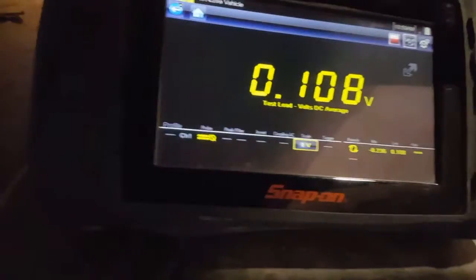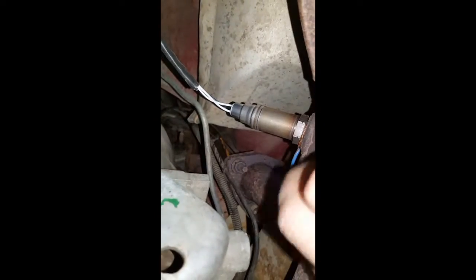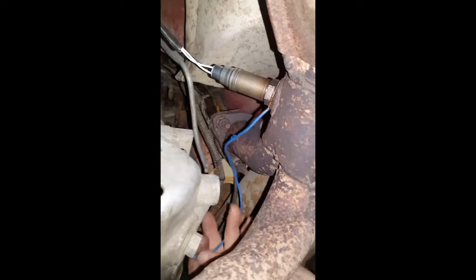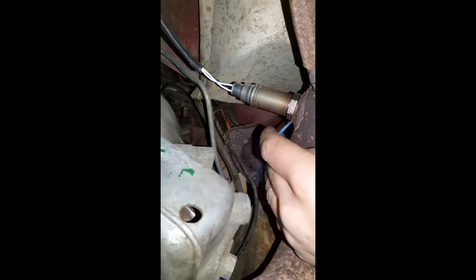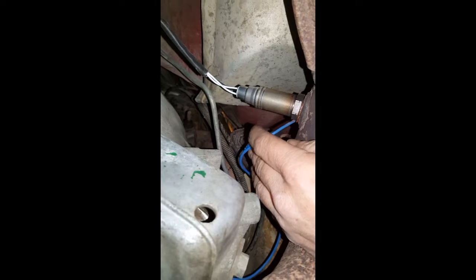It's not open, so that's not a problem here. One other thing to watch on three-wire O2 sensors is grounding through the exhaust. I ran a wire from the O2 and grounded it on the block. I did this with the old O2 but it was still sticking, so I cleaned up the grounds and ran this wire again with the new O2 just to be safe. Four-wire sensors ground through the computer, so this isn't an issue — but it's something to watch with three-wire sensors.